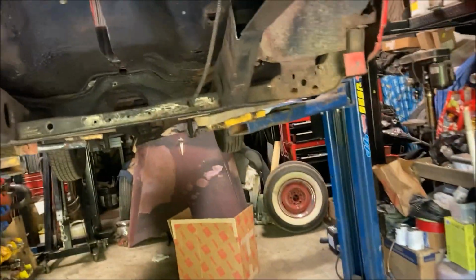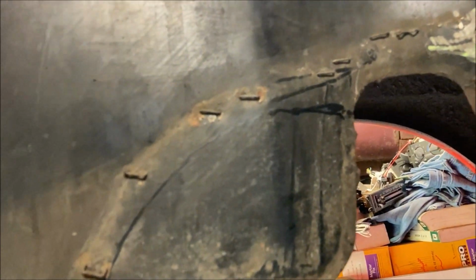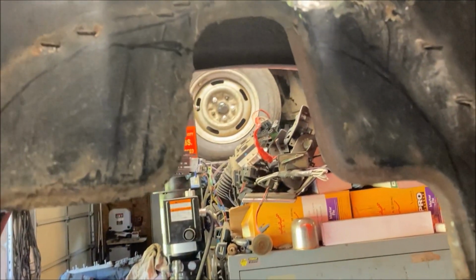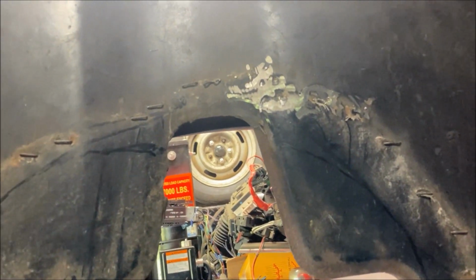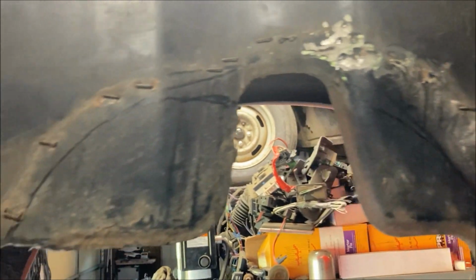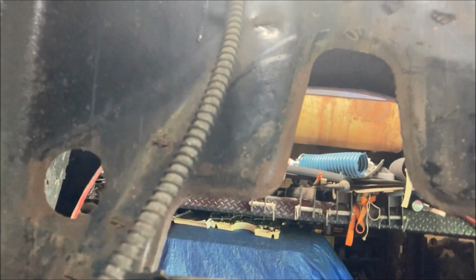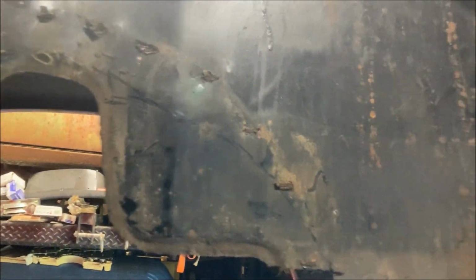Then I can actually put it in the car, but before I do that, I gotta modify these inner fender wells. You can see my marker lines in there. I gotta cut this open, so make more room for the Jaguar control arms. No big deal. And then maybe I'll staple some pieces of blue jeans on there, just like they had, and make it look just like Hudson stuff, if that was Hudson stuff. I think somebody did that. It's kind of silly.